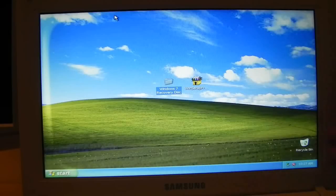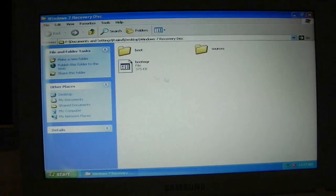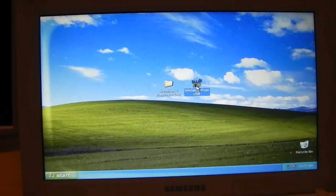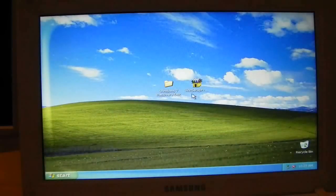It's just basically the Windows 7 setup without anything in it. The main purpose is to just recover any startup options or anything like that. So Windows is not actually in it. It's about 100 MB only, so just download it. And you can see right here, add the files into a folder right here. And again, load up WinSetupFromUSB. We're going to use the USB again to boot that up as well.